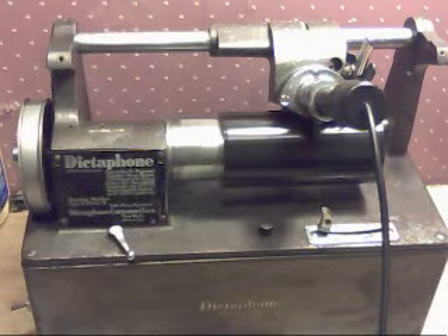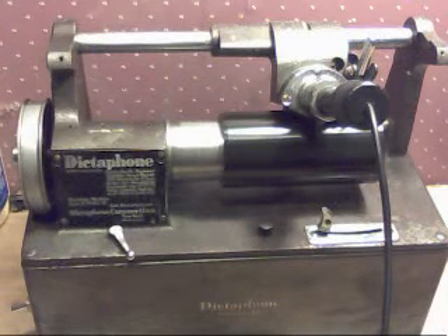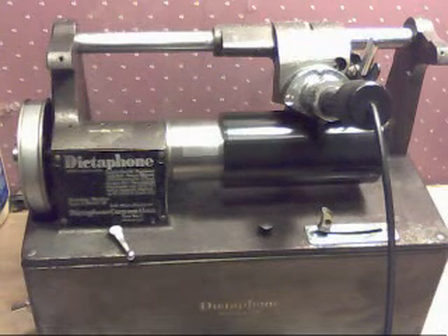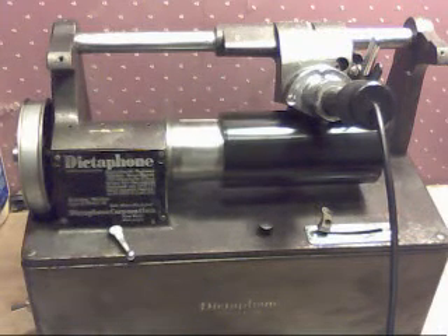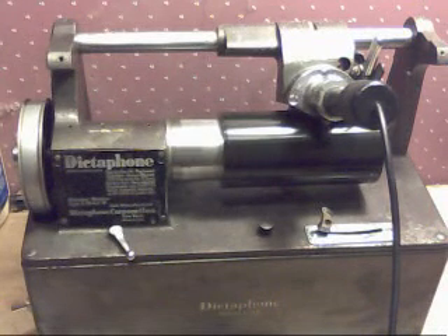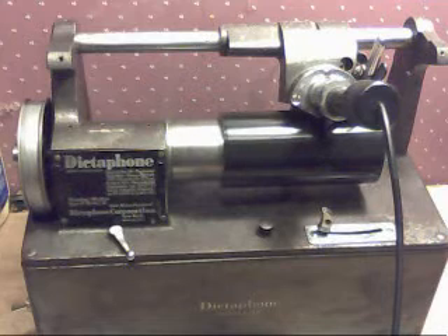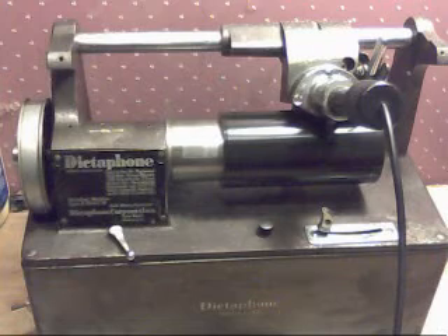If you just find an old, abused, rusted, neglected dictaphone, the chances are, when you get it running, it's going to work. I'm looking at my counter right now — we've recorded over four minutes on this cylinder, something that you cannot do on an Edison cylinder phonograph. You can record up to 10 minutes on a full-size cylinder, and on the slowest speed, over 12 minutes. So don't overlook these dictaphones. If you're looking for an inexpensive way to get into recording cylinders, these dictaphones work.